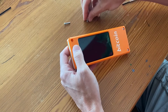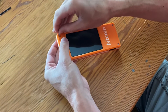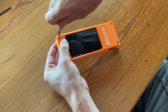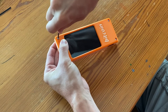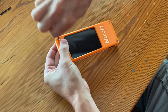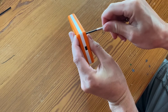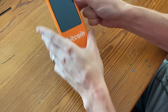This last one — the alignment's a little bit off on the design. It threads fine, but you can't push it through like you push the other three through. So I kind of set that in place, still holding the nut on the underside, but you have to turn this one to get it through both the enclosure as well as the main board. Had to get a little more leverage on it, but it's through. You can see the four nuts are seated in the back, the screws are seated in the front.